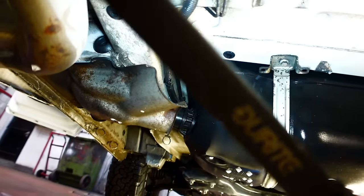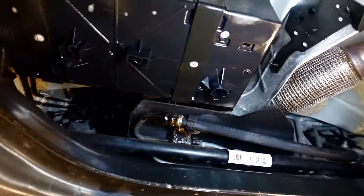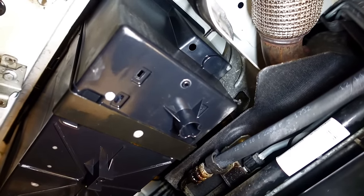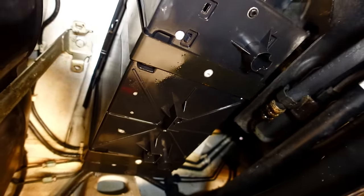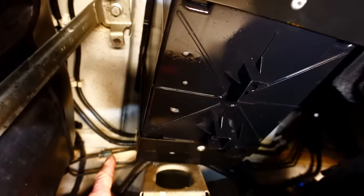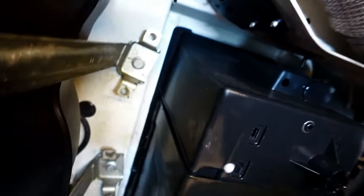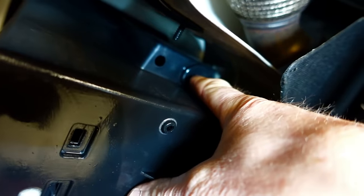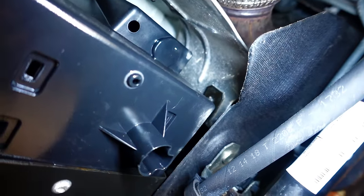The other thing I want to show you guys is where the pipes are going to run. I think the pipes are going to come around the front of the fuel tank, and there is the battery box location, where obviously the battery is inside the cab. We'll show you inside in a minute. Let me just get my light in position a little better. I'm checking this out for the routing of the pipes. I think the air pipes are going to come up round here. There's a couple of little brackets up here that I can secure them to, and then there is a hole there, which is for the battery breather, I believe. But I might be able to utilize another place in this box and run the pipes up through there. I think that's the direction we're going in.